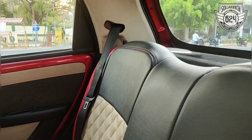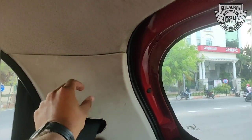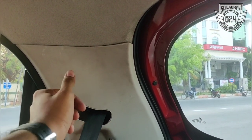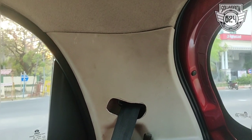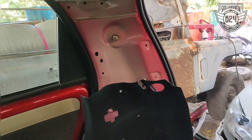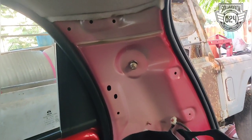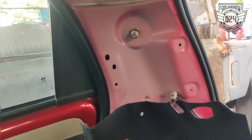There is actually a provision for the top mount — you have to literally drill the body shell and weld the bolt for the top mount of the seat belt. If you remove this plastic panel, you can see a round mark in that area, and that is exactly where you drill and weld for mounting the seat belt top mount.